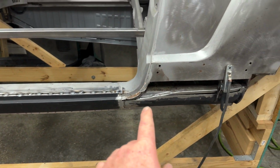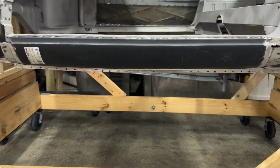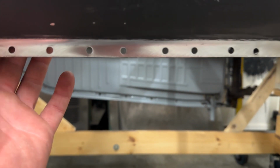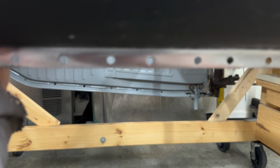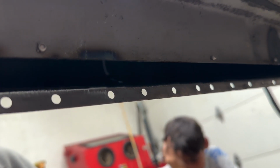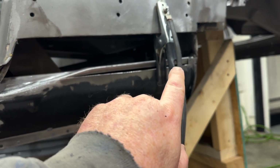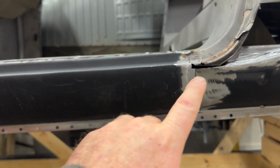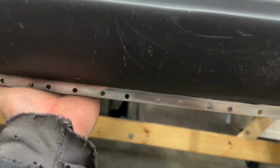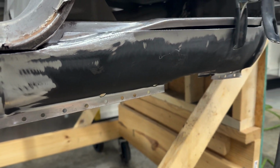All right, I'm gonna finish welding. I'm gonna weld these down both corners before I bow the bottom up. You can see that massive drop in it here. And like I'd pointed out before, I can bend this sucker way up. It's not even close to touching. So I may go ahead and just weld across here or just tack this across, get this whole upper section locked in, and then bow the bottom. Probably gonna end up taking like a 2x4 on the bottom of the floor jack and then push this up, clamp it, and then start plug welding it.